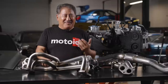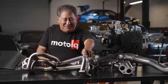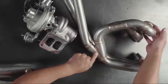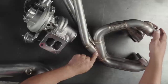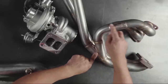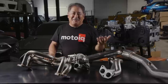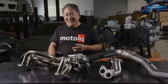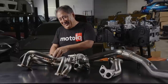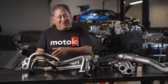I'm not going to get into the whole science of header tuning since we've covered that in other videos, but basically when the exhaust valve is open in one branch and the pulse is coming down, since they're paired in opposing points of the firing order, the other branch has a closed exhaust valve. This acts like an interference branch and gives another resonant pulse — the pulse actually goes back, hits the closed exhaust valve, and comes down. This gives more scavenging pulses over the four-stroke cycle, a broader power band, and generally more low and mid-range power.